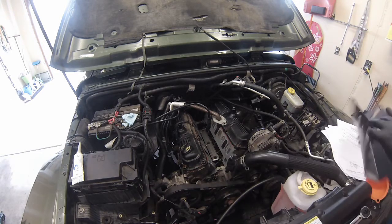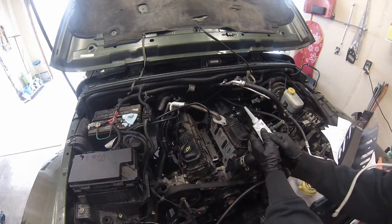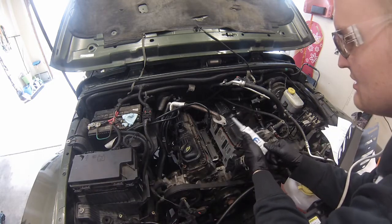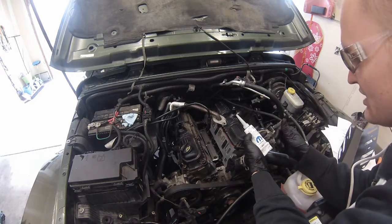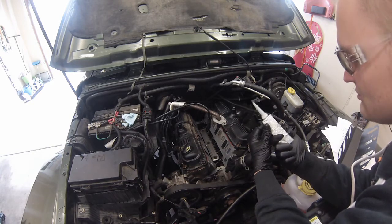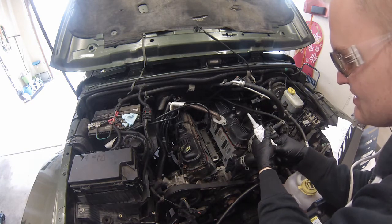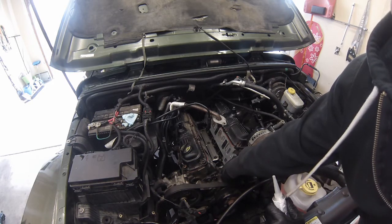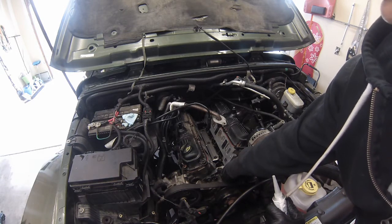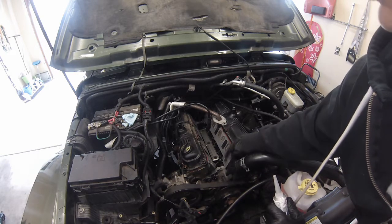The RTV — it's pretty sure it's just gray RTV, but Chrysler wants you to use their special RTV stuff. So that's what this is. You need it in four different places, basically just where you see the aluminum heads hitting the block, or where they mate right there. So there's four spots.